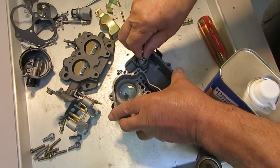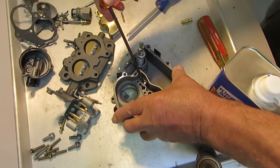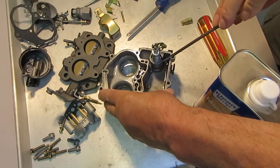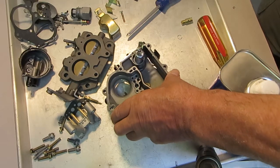And then I'm going to press down the accelerator pump, and there should be some fluid coming out of the main discharge, which I just pointed to there. And this is that little slot in the side there — that's where the fuel comes in on this particular Mercarb. This is a later model Mercarb.